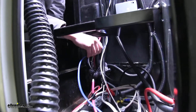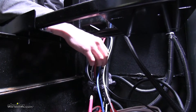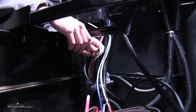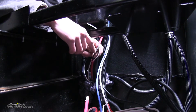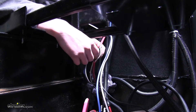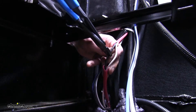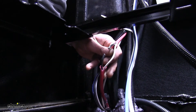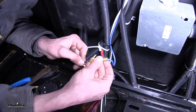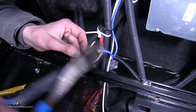Our blue wire needs to attach to our trailer brake output. We could have attached this in the junction box at the front of the trailer, but to save wire and provide a cleaner install — since there's limited space to pass wires underneath that panel — we're going to attach it to the black wire further back that connects to the blue wire up front. It's the black wire inside this jacketed red wire. We'll cut that wire in the middle, twist the wires together, place them into the butt connector, and crimp it down.